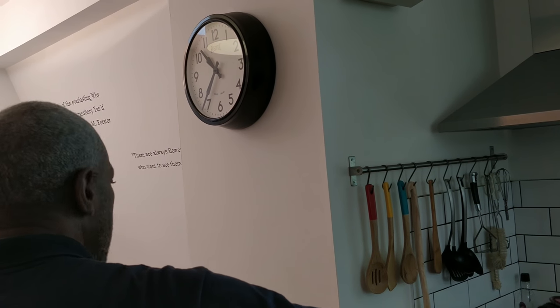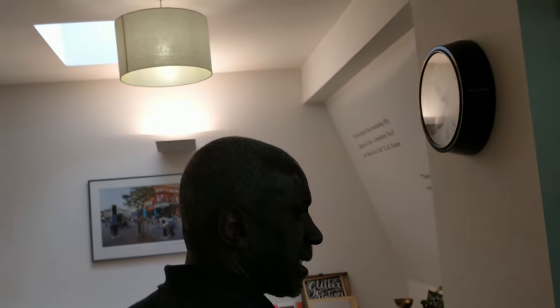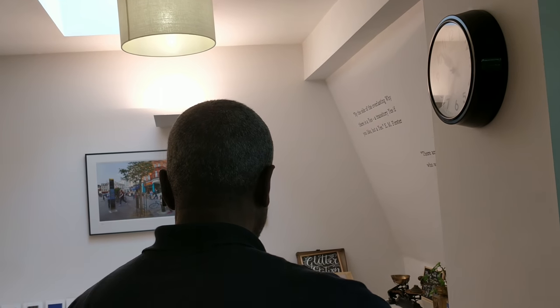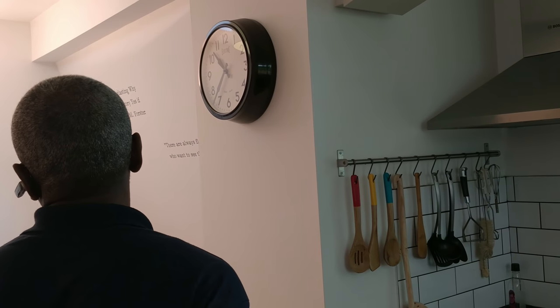So what would you want me to do? To get that socket working, that socket on the hob switch working. I could leave the cables disconnected in the back of the box until that's sorted out. And then once they've put the new ones in, they just have to reconnect that back in. Or I can connect that back in and disconnect the hob underneath there.